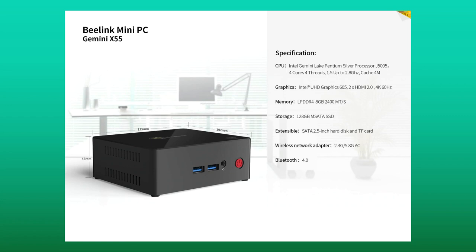You have dual band wireless, so you have wireless AC. Now, thankfully, this is an Intel wireless adapter, so very Linux friendly. Linux in the past certainly has had a problem with some wireless drivers, not Intel. Intel always works pretty flawlessly, and thankfully that's what we've got here as well. You've got Bluetooth 4, so your latest headphones, microphones, etc. should work absolutely fine on this. I've been using this with a very nifty little Microsoft Surface mouse, which is Bluetooth, and that works fine, and also an Orki digital Bluetooth speaker system, and again that's been working absolutely fine with no issues, so that's all very good.